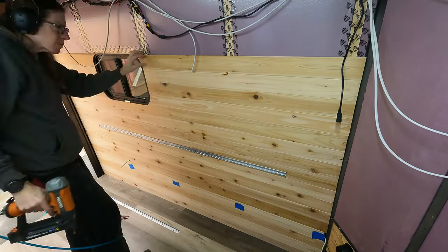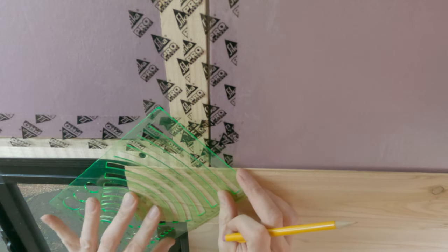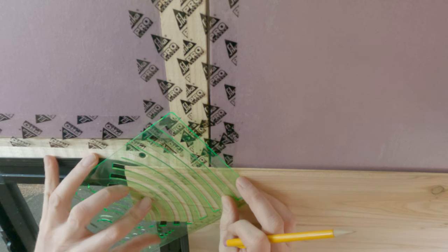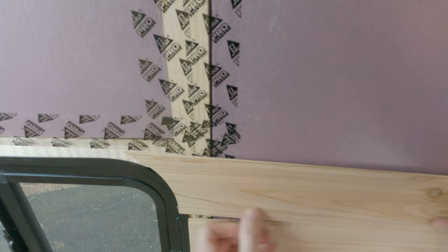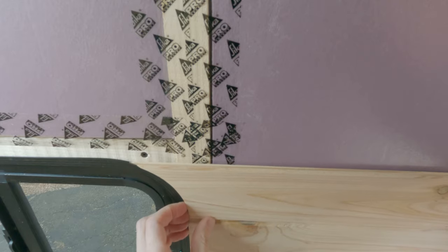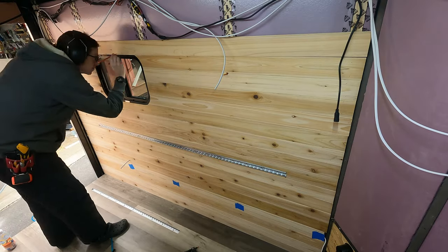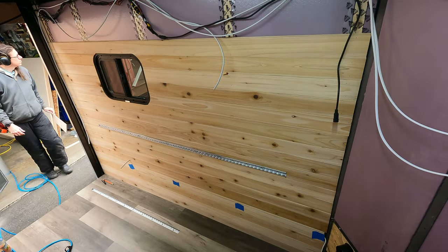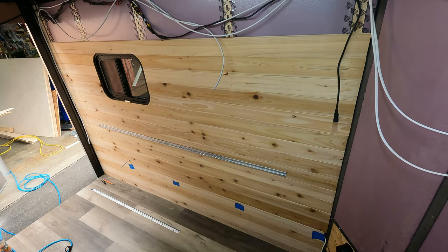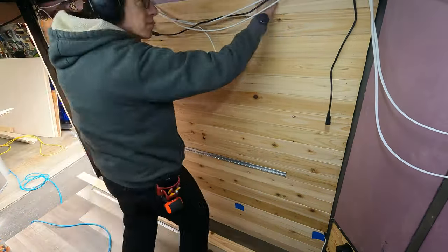Okay, so here's the shortcut that I wish I had known at the beginning and only found out on the last corner of the window. All along, I had these green templates of arcs, and the one marked 90 is the perfect window arc. All I had to do is line it up with the trim, sketch it out, and make the cut. It was so much easier. I'll put a link down in the description below in case you come across this. They're so handy to have, those semi-transparent green overlays, to get that perfect sketch the first time. Cut it, you're done. Oh my God, what a time saver.